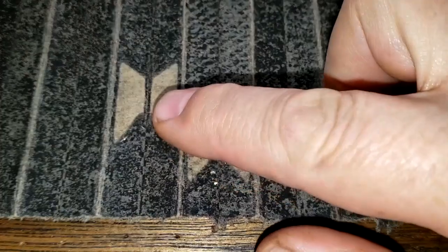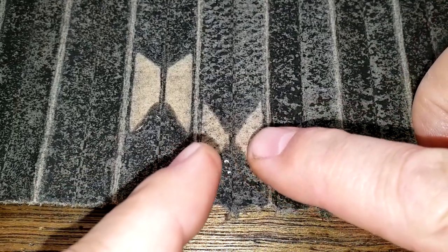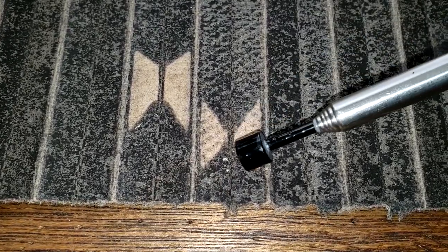You'll see there's a lot of sparklies on here. And there's a lot of soot. A lot of soot on here. And another thing, these things here, I don't understand this. This is like when the pleats were together, they were maybe stuck somehow and the oil wasn't even filtering through them because they came out really clean like that. And throughout the filter, you'll see it. Actually, some sparklies right there. Let's check these guys out.